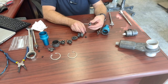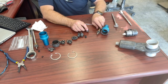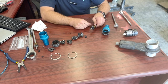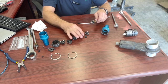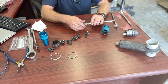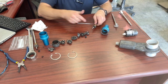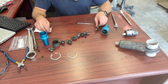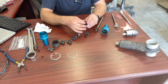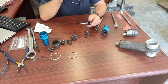It goes away if you replace it with the AL-3. The shorter one fits inside of the axle like that. The longer ones will stick up and gap, and it won't fit in your housing right. All of them use the same exact gears, so any of these gears can go on any of these spots.